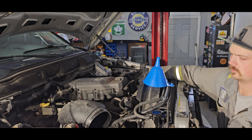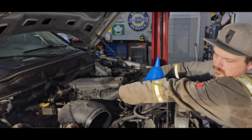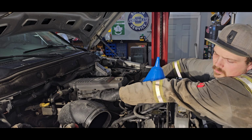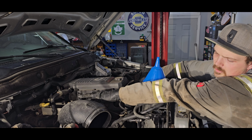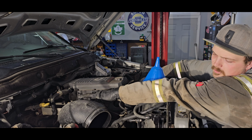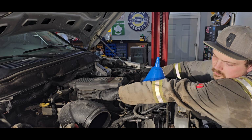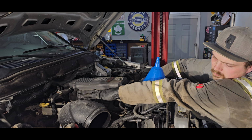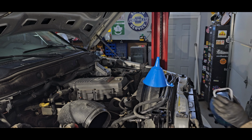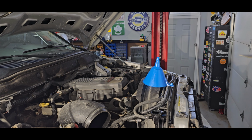The trick I learned over the years, if you plug your vent and you pump your glycol hose, well, you just keep going until all the air bubbles are out. It acts as a little pump and starts sucking out of the rad and putting it into the block. But we are looking pretty full here now. A few more bubbles coming out. Got some pressure on the hose, which is good. One there. Perfect. Okay, now we'll fire up the truck, pump it through, open up the rad cap again, keep topping it up until we're full.